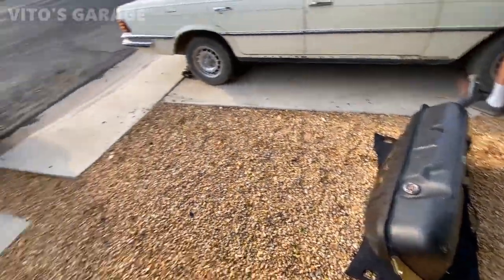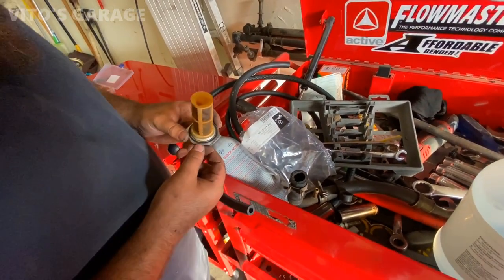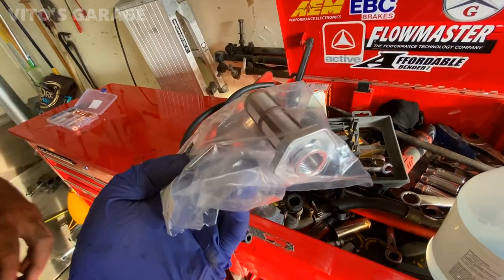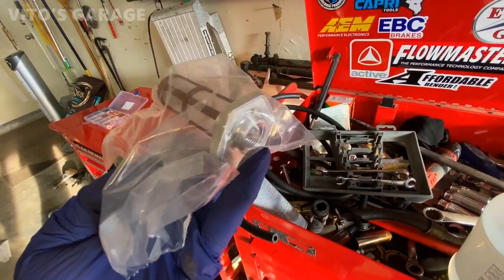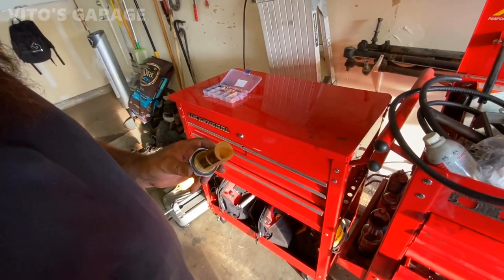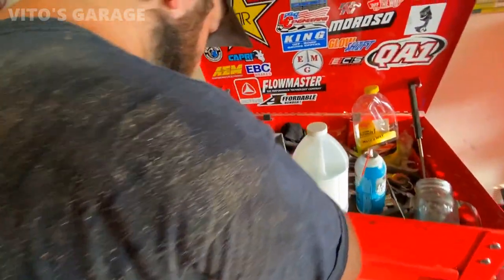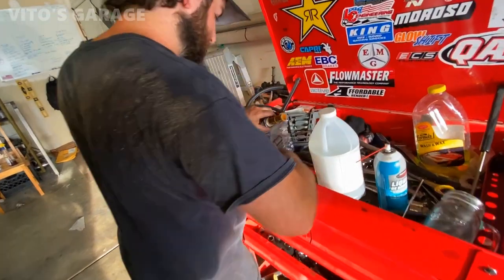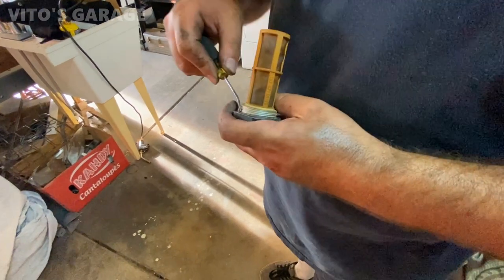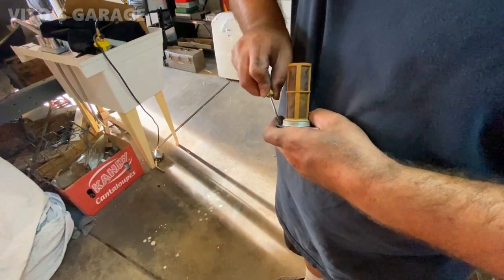We're ready to install this tank onto that bad boy. So we're gonna clean this old strainer out and use this one with a new O-ring, because this one is actually for the diesel, so it's a little bit different diameter thread right there, so it's not gonna work. But this is in pretty good shape, just have to clean it. But for this, you have to use a pick to take that out. I can do it if you want. Yeah, go through the other side. From the outside, uh-huh. Sometimes they're stuck on there.